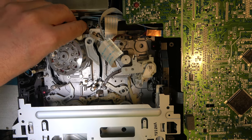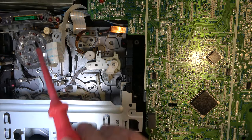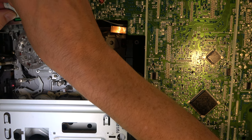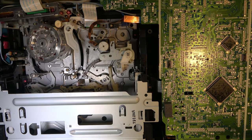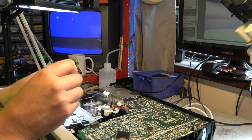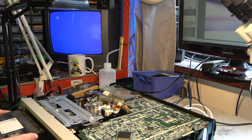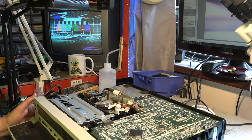This cable I failed to disconnect when I was pulling the head drum out — it would have made my life easier if I had done so first. There are those who would say this head drum cleaning device is nothing but a nuisance and should be removed; I don't subscribe to that — I think they are useful, but sometimes you do have to replace or clean it. It's fully reassembled — Schrödinger's video recorder at the moment, does it work or not? Actually, I haven't refitted the earthing contact, and without that you'll get what looks like drop-outs on the picture. So we really need to do that. Now we'll try it. This has got itself into that pickle again so it's obviously popping off, and the result is depressingly similar.